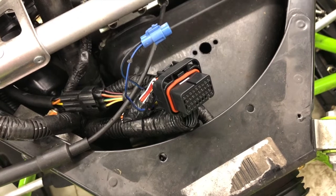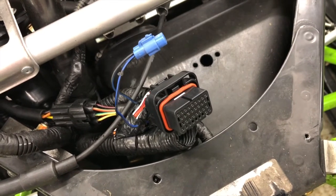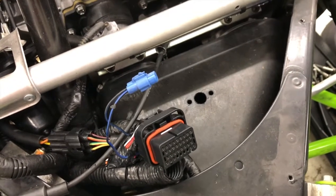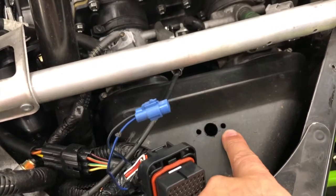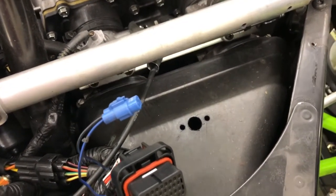Stock, they're mounted up on the hood close to the handlebars. When you go to the cold air intake hood, or just even in general, it's not even a bad idea to relocate the air temp sensor to the air box, because the motor seems to run a little cleaner — it's getting a more accurate temperature of the air going into the motor directly. We just drill a half-inch hole and then two 3/16 holes on each side for the air temp sensor, and the sensor will simply pop into place.